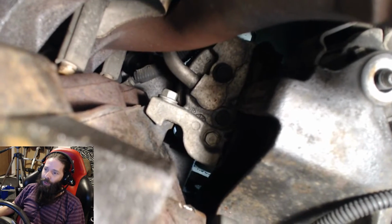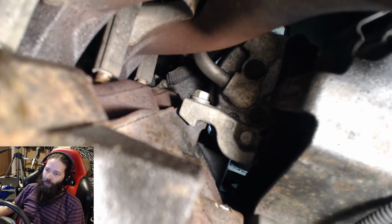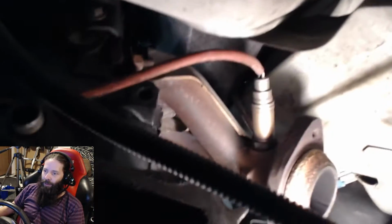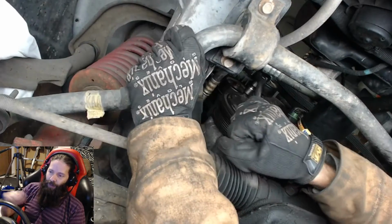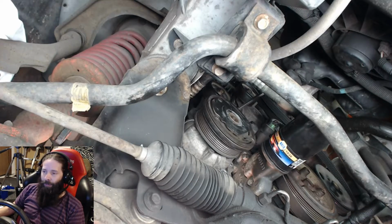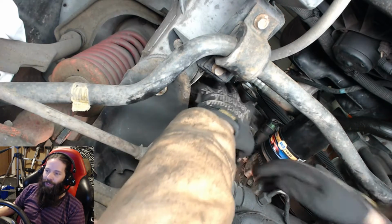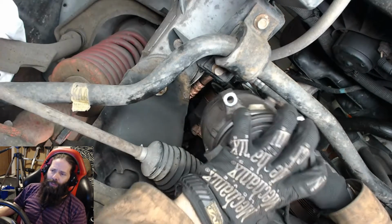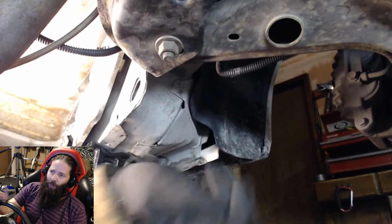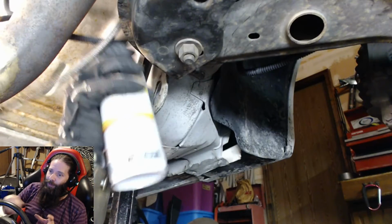And back there, I'm going to pull the AC pump out, which, interestingly enough, a car shop told me I needed to do because the AC pump is bad. I had it checked, and the bearing seal in the shaft is where the AC coolant is leaking out, so it's got to go. It had to go anyway, because that's the only way I can get the engine mount bolt out. In order to do this in the car, without pulling the engine, you have to take out one side and loosen up the other.